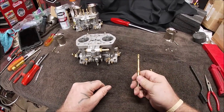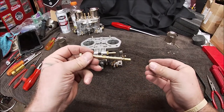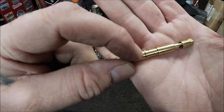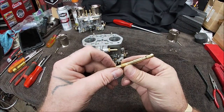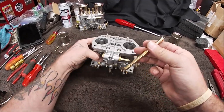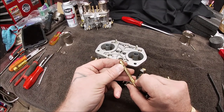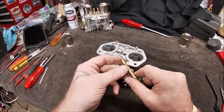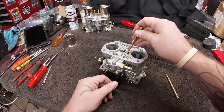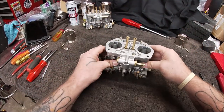So now you're going to take your main jet stacks. And by the way, when I took it apart, these just fell in half. Now, if you can see, there's a small slice in these. I crimped it so they were tighter, so they held together. The one thing I'm not impressed of is we have the F11 and a 115. I believe that's what it said now. And there's no numbers on anything else. Isn't that great? You get what you pay for sometimes, I guess.